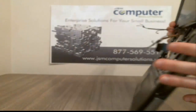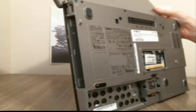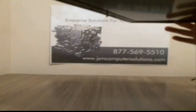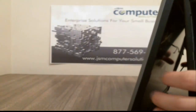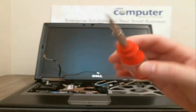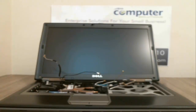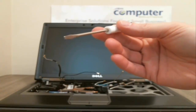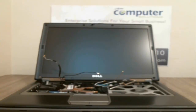Now we're going to take the screws out from the actual monitor. There's one right here that has a D on it, and then there's one on the front here as well — they're on each side. Before we get too much further, I just wanted to go over the tools we need: a regular Phillips head screwdriver, the small kind — I believe this one is a CR7. And then I usually have one of these pry tools; they're easy to pull up cables, and we actually used it to flip up the power button bezel.